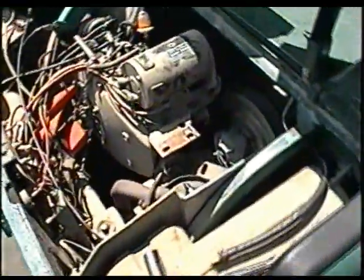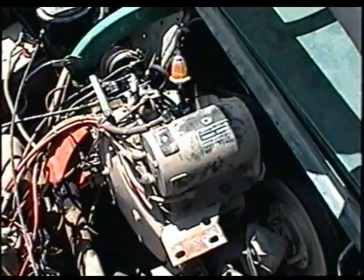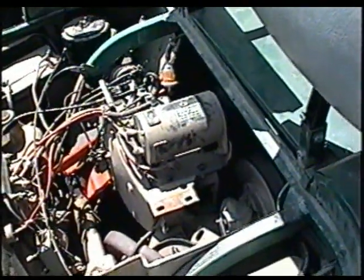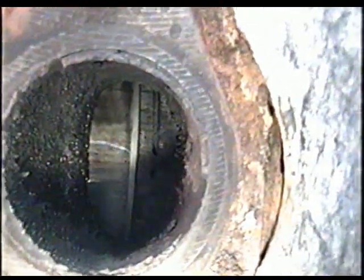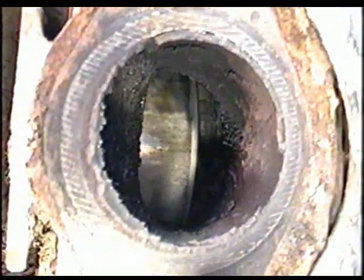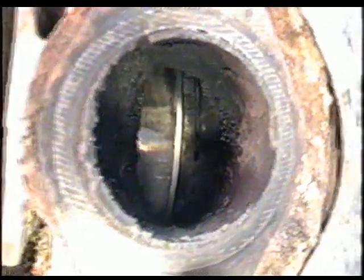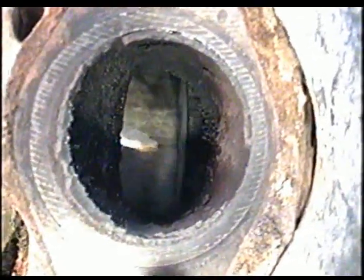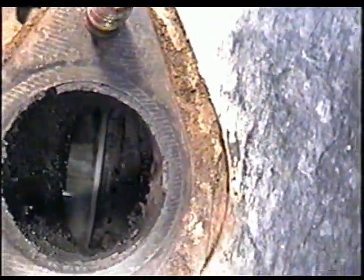What I've done is I've removed the muffler so that I can see the piston and the rings under there. I'll show you what's going on. So I'm underneath the cart right now, and here's the piston — you can see that there is a whole ring missing on the top of the piston. Look at that, no wonder it's got low compression.